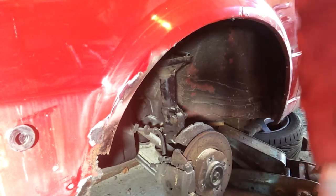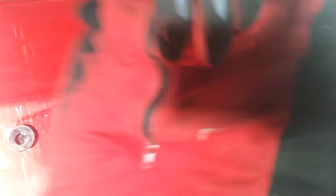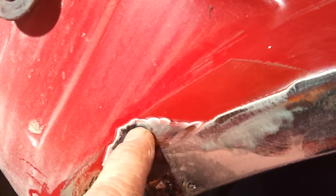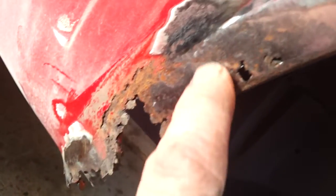Now we'll bring the camera a little bit closer and we'll see what we're doing here. Right — there's a fair wee bit of light shining here, I don't know where it's coming from. You can see a log here — that's down to pure bare metal. Still a bit of rust and corrosion in here. I'm going to try a little sandblasting gun, but just where my fingers run along there, that's all the way to the tin — that's what we want. Down to there. This rougher stuff, I'm going to cut this out. Get a cutting disc, cut out the log. Right down here, along the top there's a wee bit more — bubbly-dubbly.